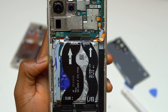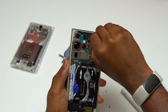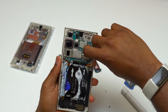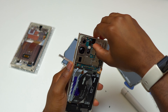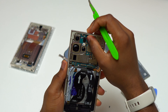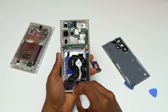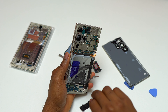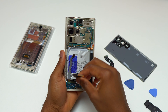This battery needs to be replaced and I didn't feel like the back cover was ever removed from this device. I'm not sure how, but Samsung put this battery inside. The next step is disconnecting all the flex cables connected to the motherboard and removing all the other components attached to it. At the bottom of the device, the loudspeaker is held by six screws. After removing those six screws, I can remove the loudspeaker and have access to the charging module and the other ends of the flex cables.